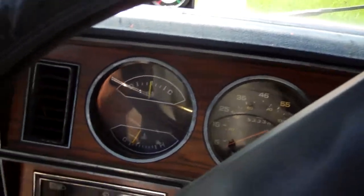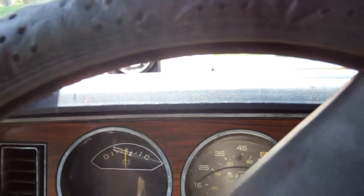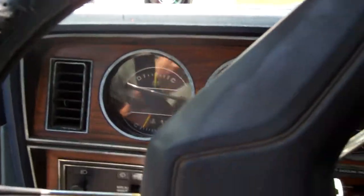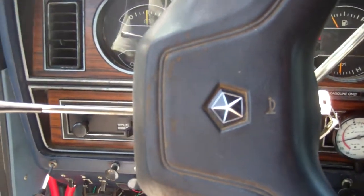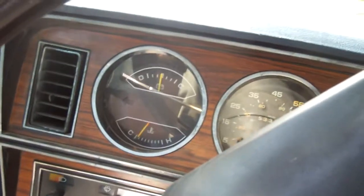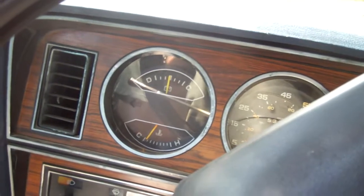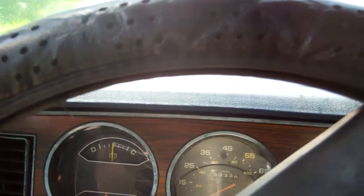and that'll be easier to tell once you're really up at speed, because you'll be running maybe 15 and that'll be maybe 5 or something. Then you say, oh, that's 15 and 5, that's 3 to 1. So when I'm running on gas, we want it to be more or less in the middle. It can move around some. Wood would probably be down here. On gasoline, don't worry about it too much because it may disappear down here in the lean.